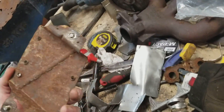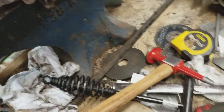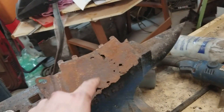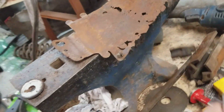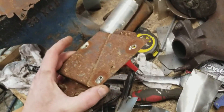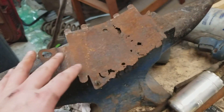I just wanted to take a minute to show what I'm doing. This piece was actually rolled up in a half circle and then bolted to this one. Obviously the casing is completely disintegrated, so I figured nothing too complicated. So I'm going to just mimic this — I already hammered this out straight, so I'll be able to trace the shape onto the sheet metal.